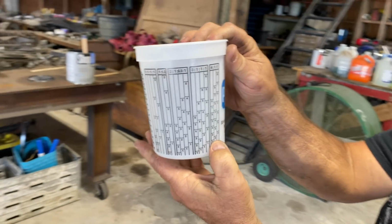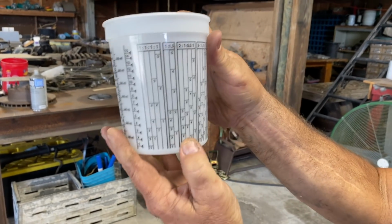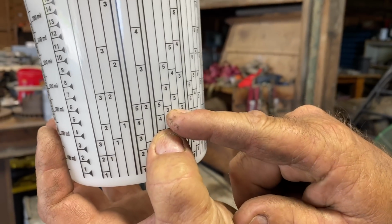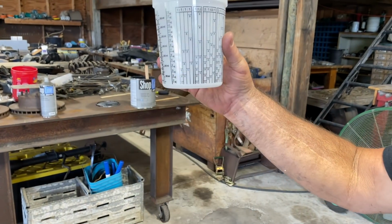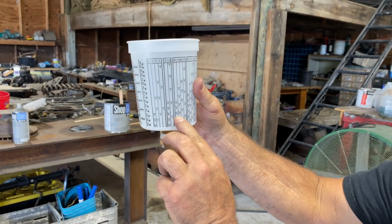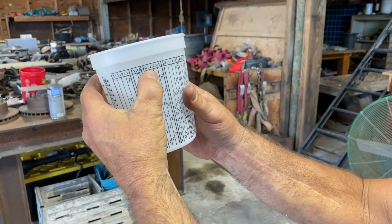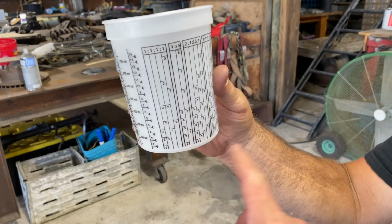So, you pour here, then there. It's a lot less hardener, where the epoxy takes a lot of hardener. Okay. Let's go to the 3 so we don't confuse. You pour your 3, and then you go to the next 3 with the hardener. So basically, you always pour your primer first in your first column, in the 2 column, however much you want to make. I get it now. This is your hardener column. And then if you wanted to put 5% reducer, you could put reducer in. I understand now.